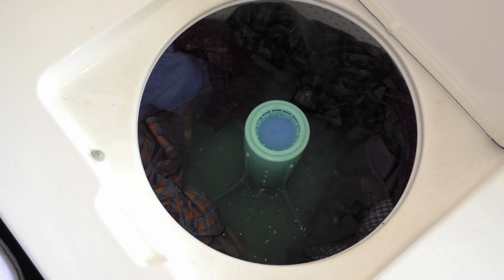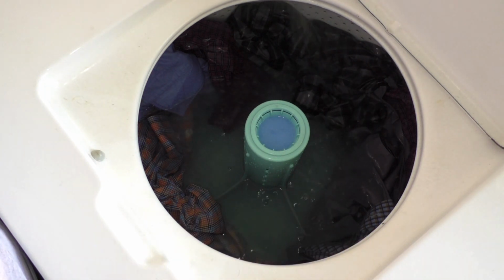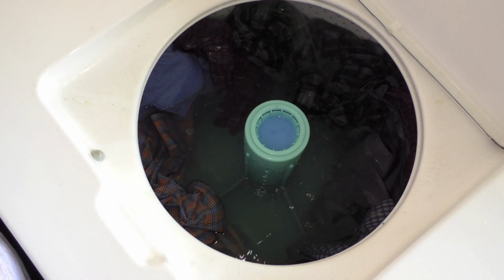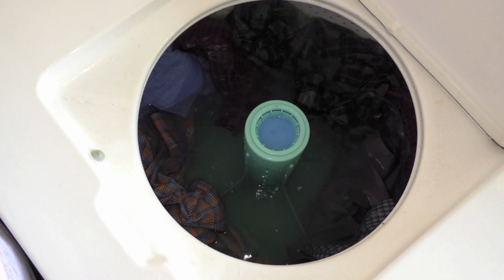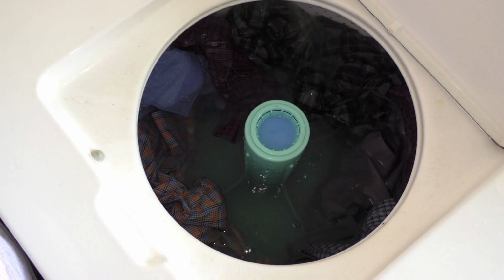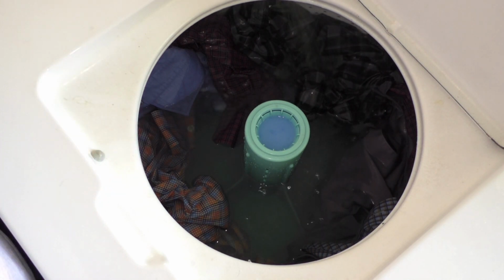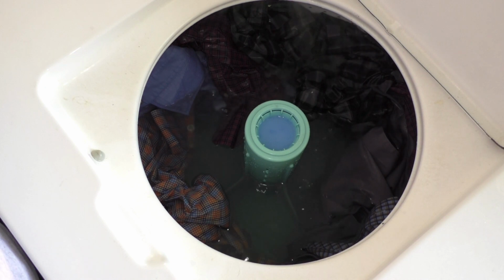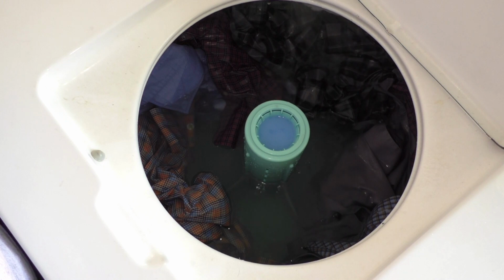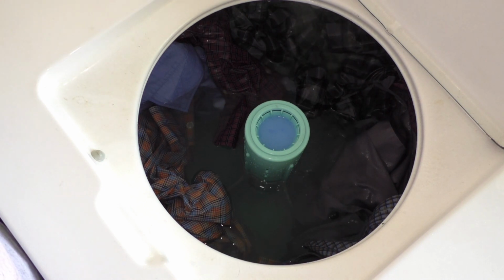I think the other big difference is that by the time the A606 permanent press model came along, Maytag had added 4 water level selections or load selection levels, and the non-permanent press model came with only 3. But then with the A608, there was an additional upgrade. The A606 only came with 3 temperature selections, but with the A608, that was upgraded to 4 temperature selections. So there's hot, warm, hot, cold, warm, cold, and cold, cold. But the timers are identical, and they're both large capacity tubs.